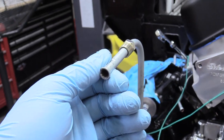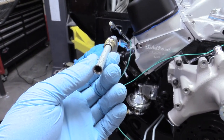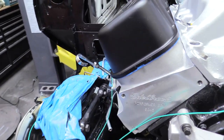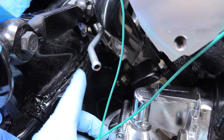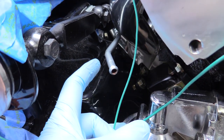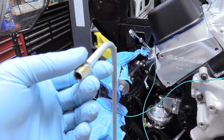Before we wrap up, here's a double flare line for a transmission cooler on my 1967 Camaro. See how it uses the exact same double flare and a similar flare nut — just a bigger size for transmission lines. And back here, that looks just like the first bubble stage of the flare we did — this is an old school fuel line where a rubber hose fits on the end and the barb prevents it from slipping off. This flare line skill is imperative to working on old and new cars, because new cars still use this for transmission coolers and brake lines. That is how you use a double flare tool to create a brake line — very simple, very straightforward, and an essential skill if you're working on brakes or doing a custom car. Thank you so much for watching and we'll see you next time.